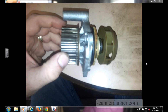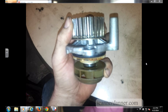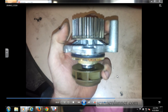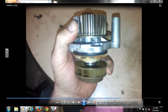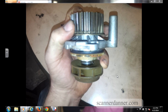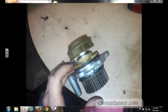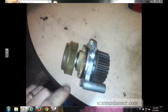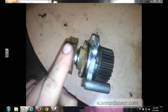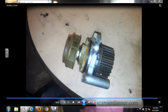This is not a common issue in my experience, but from the comments from you guys this was a real common issue on Volkswagens, so this is something to look for. One suggestion I liked a lot was to check the heater core temperature — warm the car up, look at your temperature gauge, and as the temperature starts getting hot, turn the blower on and heat on max. If we have a water pump flow issue, the heater core is going to be cold and so the air is going to be cold. That's a very valid test.